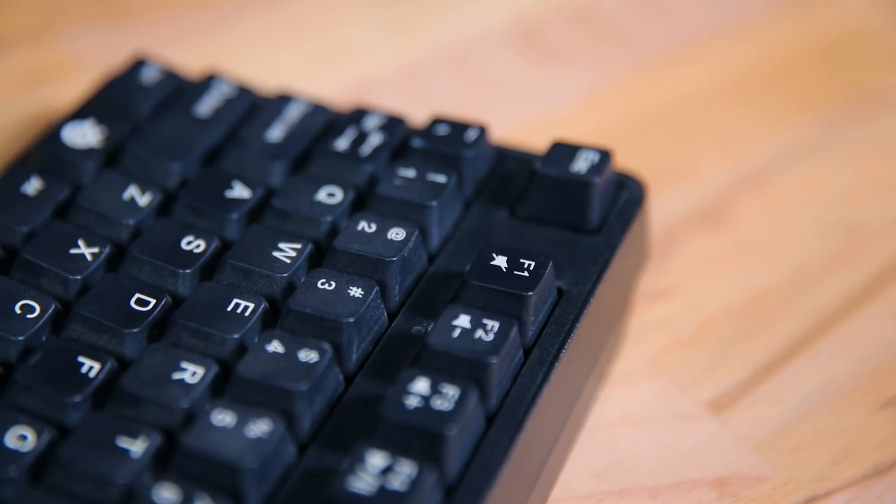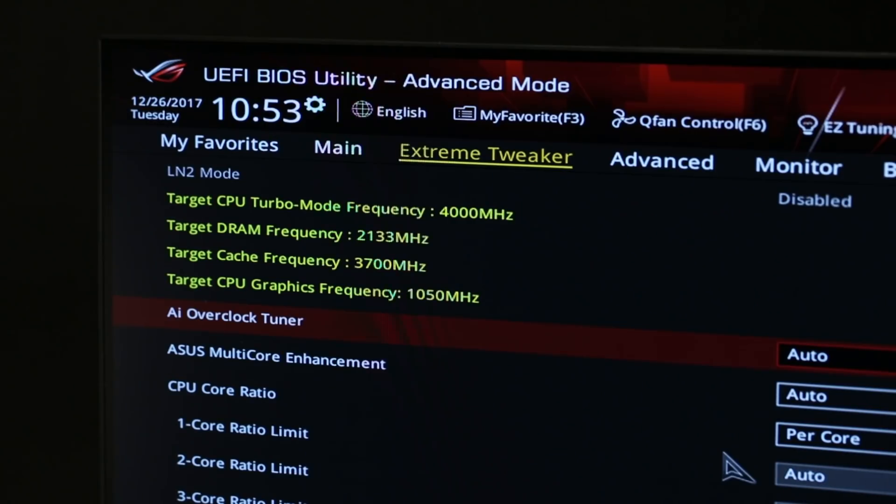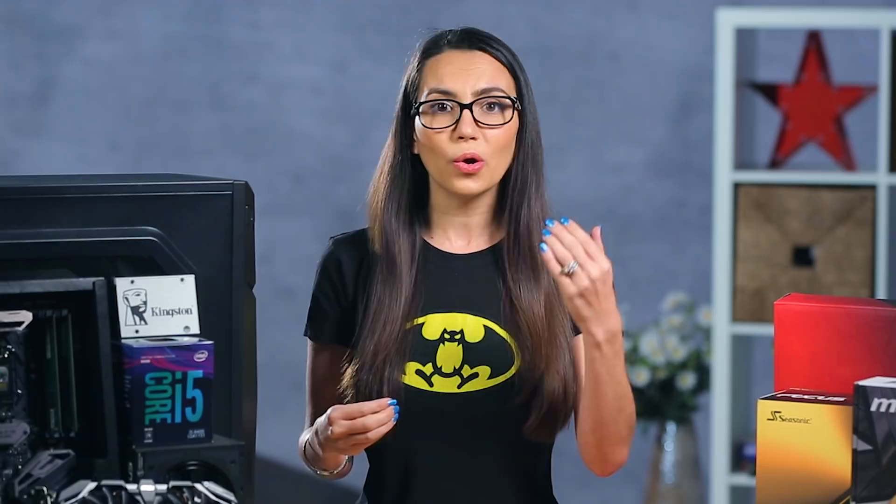Let's assume things are going smoothly and you saw that motherboard screen. Now it's time to adjust the BIOS/UEFI by pressing F1 a few seconds after boot. Set the date and time, and if you like, the default boot order. At this point, you can install your OS of choice via thumb or optical drive, and feel free to do a victory dance around your room because it's well-earned.